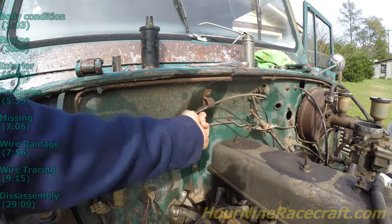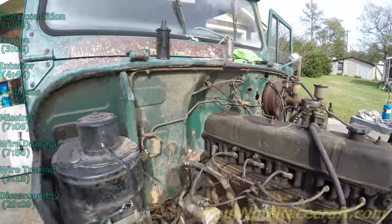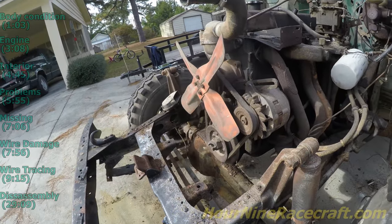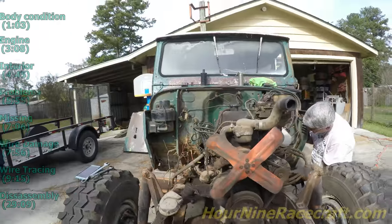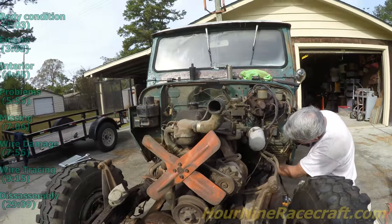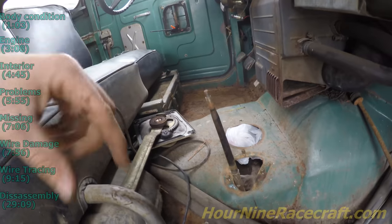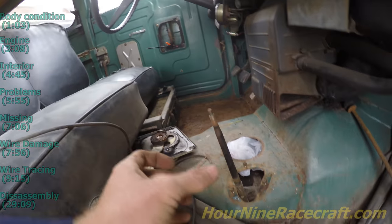The original choke cable — this is the one that was on it and this is the one that was pulled off. I'm pretty sure that was the old choke cable; we'll find out more whenever we get under the dash. The clutch system was completely dry when we pulled that off. It looks like the same type of slave cylinder as on my '95 Toyota truck. Also, all the 10mm bolts broke on the fender — they go through the fender; there were eight-millimeter-head screws with 10mm bolts on the back and little square nuts that are supposed to be weld-on nuts — those were broken off. For the main shift lever, it's like an old-school bulb assembly with a little J-hook — you press down the collar and turn it counterclockwise to release, then the whole lever comes out.